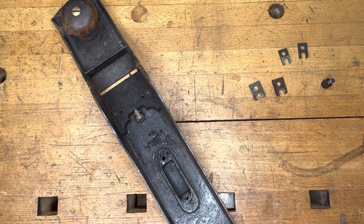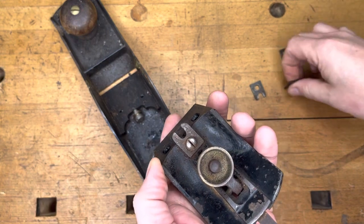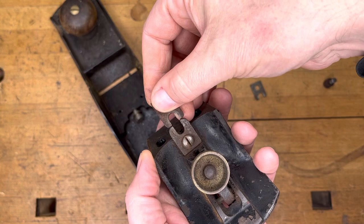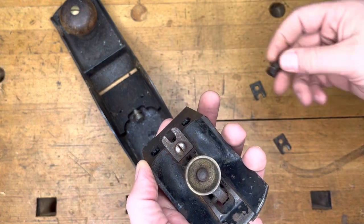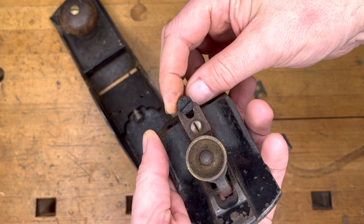Before we move on from this type 1, let's talk parts stuff real quick and compatibility. As a part supplier for parts all over the world, this is pretty important stuff. You'll notice that this is a slightly different width. These early screws were actually smaller, and this plate was actually smaller, because, for example, here's a later screw, and you can see that that does not fit in there.